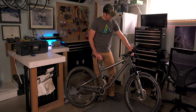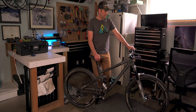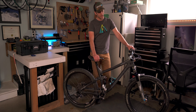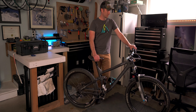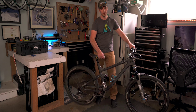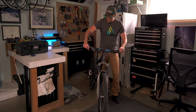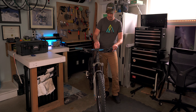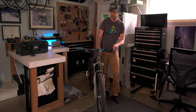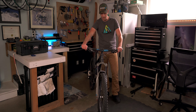The saddle's been the same forever. Bars are about 780mm wide, which is plenty wide — I'd actually probably go a little narrower, but they've been very good. It's quite a flat handlebar with maybe a 10mm rise. I find that putting in spacers and the stem brings it up to a good height for me and keeps me nice and low, so I'm a little more aggressive.